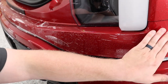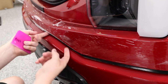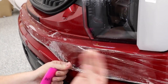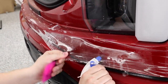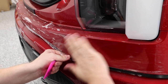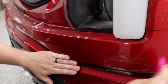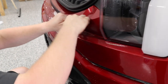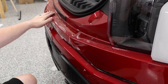As you saw, the way the film was twisting before, it was creating all kinds of fingers and bubbles. What I'm going to do is get my hand underneath there, lift that up, get rid of all that, and get more slip solution in there. Take my hand, force all that down, come right along the top, and squeegee that down. Now we're going to go over to the passenger headlight, get that down, and then deal with the middle afterwards.